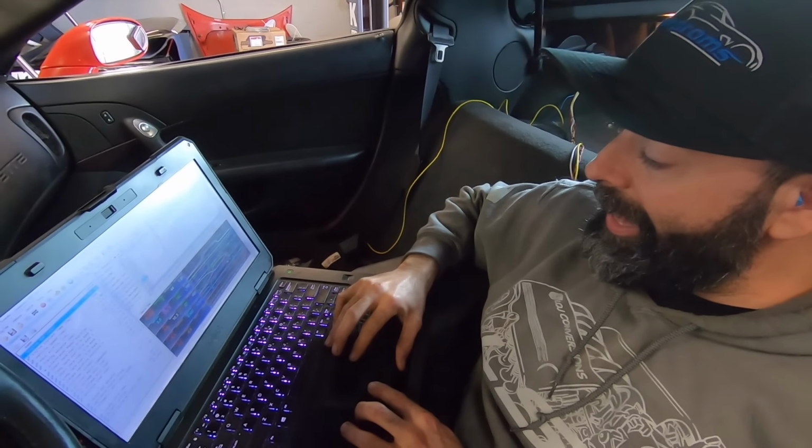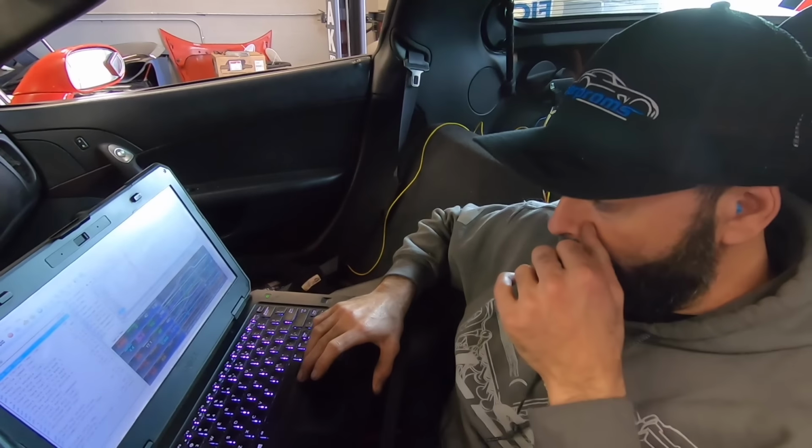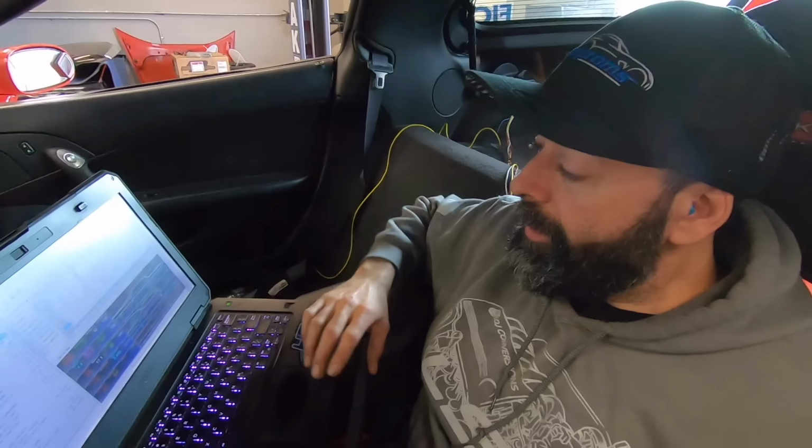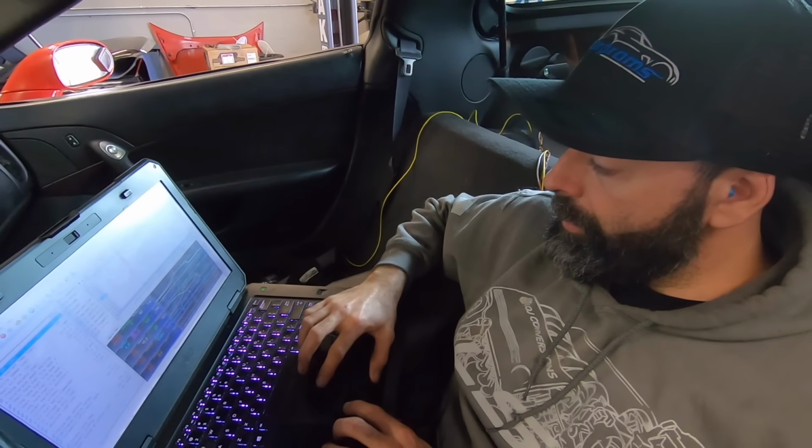Off at 22 and then it trailed down, it actually dropped a little bit at the top there. So really, we dropped like 2 pounds. Look at the curve. It goes up and it just kind of plateaus. But it plateaus because we're dropping boost. That was cool, what did it pick up, 2 pounds then? No, we picked up probably as much as 4 or 5. But we should have used a smaller drill bit.